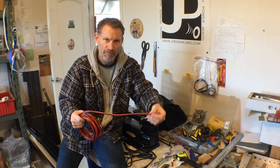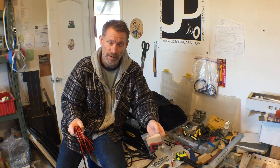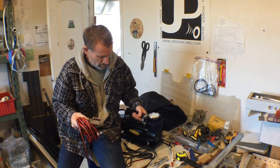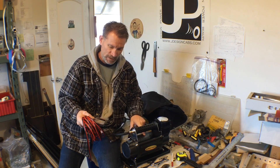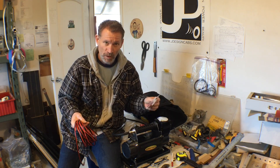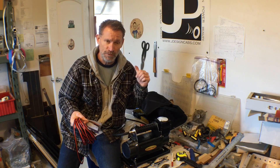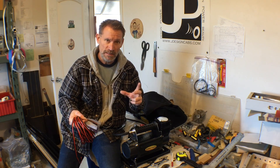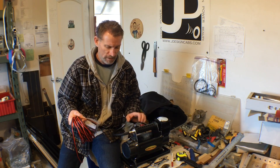This is 10-gauge wire. They have 30-amp, 45-amp, and 15-amp connectors. I used the 45-amp connectors because this air compressor has a max amp draw of 45 amps — I wanted to make sure I covered my bases. It would probably hold the 30-amp just fine. The inline fuse I put on the truck lead is a 30-amp automotive style fuse, so that'll pop before anything else in the air compressor. The air compressor also has a built-in breaker as a fail safe.